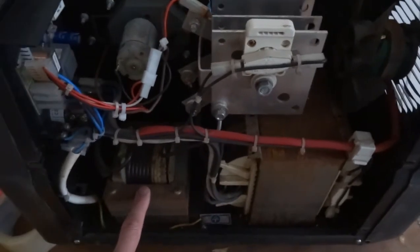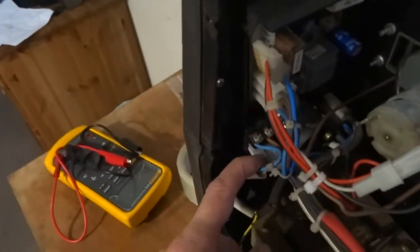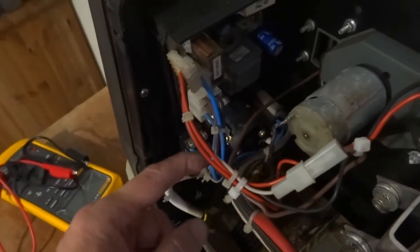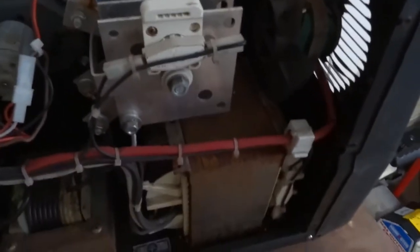If your transformers are gone, it's going to be too costly to repair, and your choke as well. Other than that, you've got your on and off switches - test them for continuity. I've got a video on that. Just make sure all the wires are solid and tight, and that is all that really goes wrong with these. Pretty reliable machines and pretty well made, except for the motors which are poor.